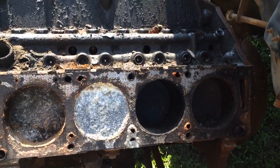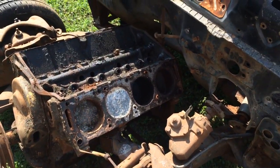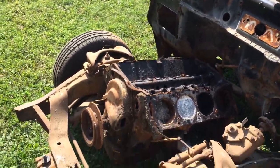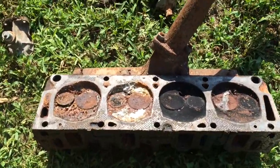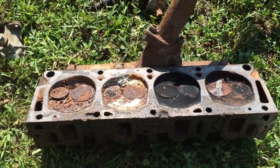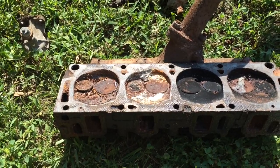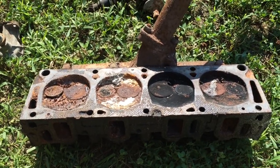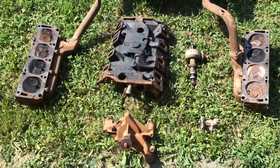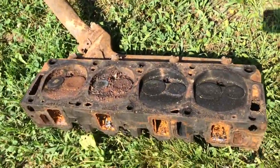I was thinking this is what every cylinder would look like, but in fact only these two cylinders. However, I did go ahead and remove everything that I needed to with the hopes of breaking this bad boy loose someday, sooner than later hopefully. Down to the heads — the heads, as you can see, are rough, but I think with some good rebuild work and soaking they'll be back in business before we know it. Starting from the ground up, let's take a look at this passenger side head.